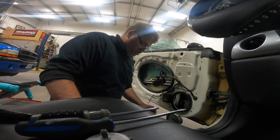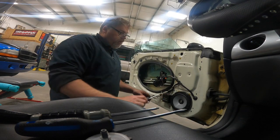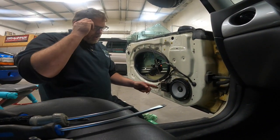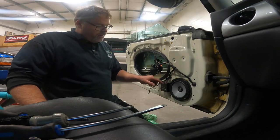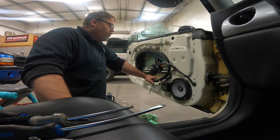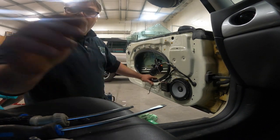There we go. So now put the speaker back in. I've taken this door panel apart twice now and both times this thing's fallen off — the helix there, the old crossover mechanism. So I end up putting a dab of urethane on each side of that so it won't come off, because it exposes all the crossovers and everything to moisture. So we get that on there so we don't have to worry about that coming off again. Now that we got that on, we should be able to go up with the door glass.